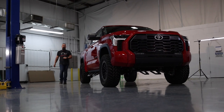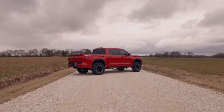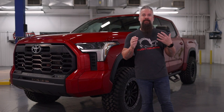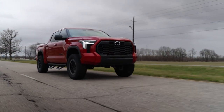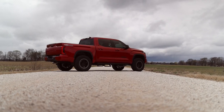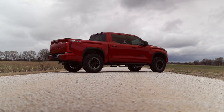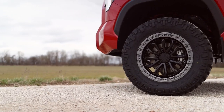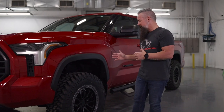On this episode of The Build Up, we concentrated on how subtle changes can make dramatic differences — and the end results speak for themselves. First and foremost was the Rough Country 3.5-inch lift: not a massive lift, but bigger than a leveling kit, and all we needed to run 35x12.50x20s. The kit includes upper control arms and differential drop brackets to maintain factory geometry up front; lift is achieved with a strut spacer. Out back we used a coil spring spacer, along with a track bar bracket and shock relocation brackets. For wheels and tires we used a Nitto Trail Grappler 35x12.50x20 wrapped around a TIS Off-Road 556BA.